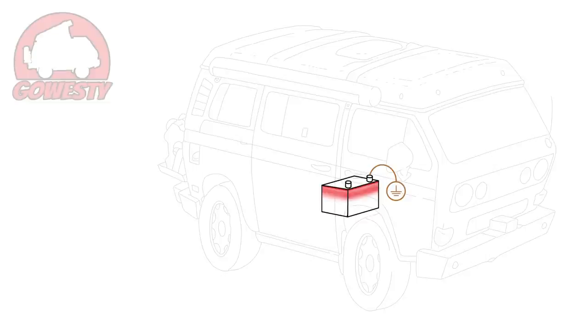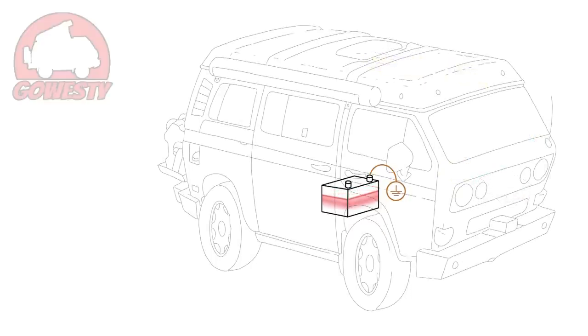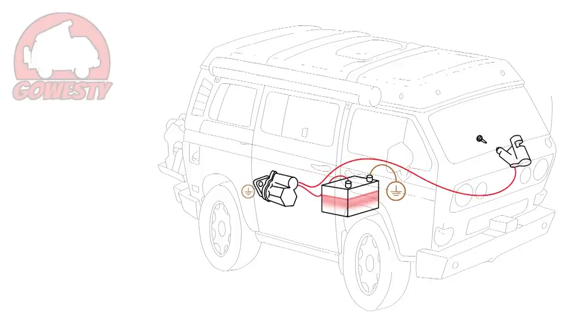All electrical accessories use the starting battery for power. This includes things like lights, power outlets, and stereo. A simple dome light will draw a low amount of power and is fine for everyday driving, where the battery can easily recharge. However, in a van — especially while camping — using the lights, auxiliary outlets, and listening to the stereo will use quite a bit more power. Even though the battery is not completely dead, when we try to start the van, there isn't enough power to make the starter turn the engine, leaving our van inoperable.